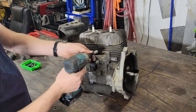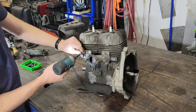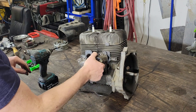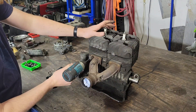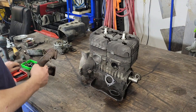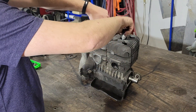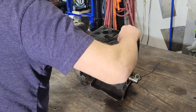We've got six that need a 10mm socket. This should pop off — a couple of gaskets. Same deal on the exhaust side, some gaskets. The exhaust side looks darker than this side — more carbon or something. Spark plugs are just hand tight, so I'll take those guys off, and I'm pretty sure these are 12mm up top.